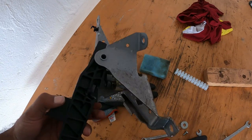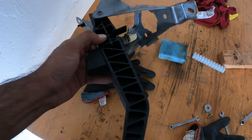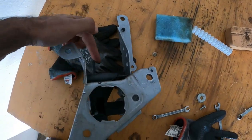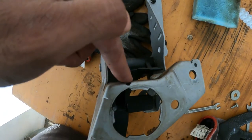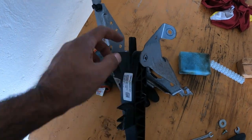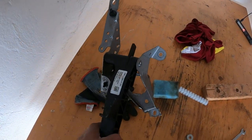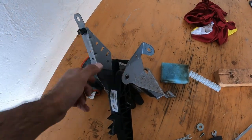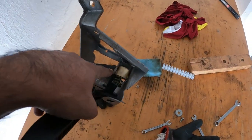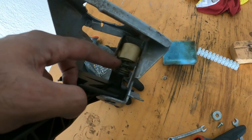The problem was there is a spring here that goes from here down and fixes here. The spring broke, and then when we tried to put a new spring in while this was inside, there is a small notch here and we broke this plastic, so we had to change the whole pedal. The new one has this hook, and the spring was there, but when I ordered it from the used shop the spring was not included — luckily I had already bought the springs from Ford. It was a bit tricky to change; sorry I couldn't show you, I was too busy with it.